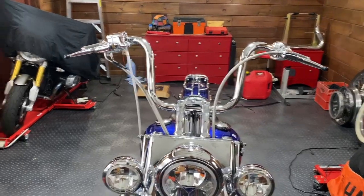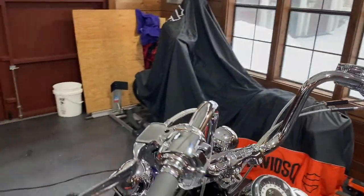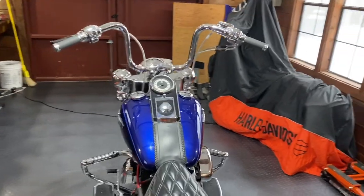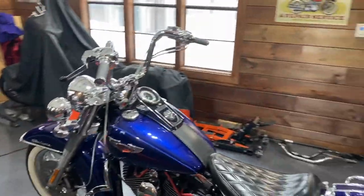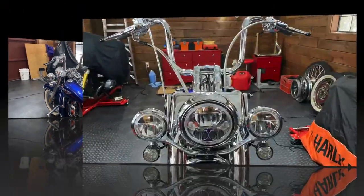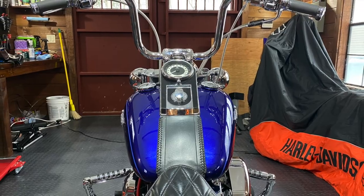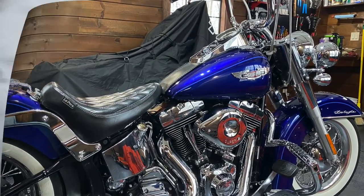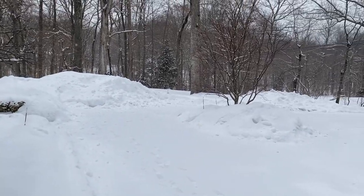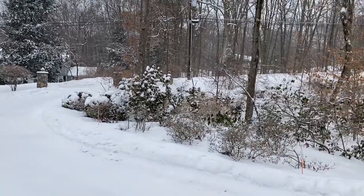You just need enough to make a clear turn and not put too much pressure on the cables themselves. The clutch cable came out really nice — a nice tight sweeping arc. Throttle cable, brake cable — everything's got enough play without having too much excess. You can see how it arcs over into your riding position, so it's a pretty nice combination of where I like the handlebars to be. Anyway, thank you for watching — no blowtorch required. Now if it'll only stop snowing I'll have time to get out there and ride. Can't wait for spring and summer, but it's a good winter project.